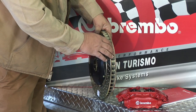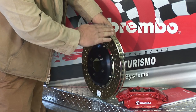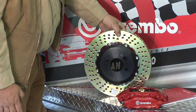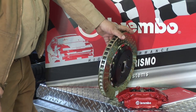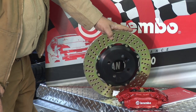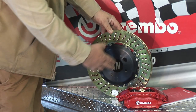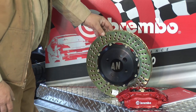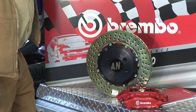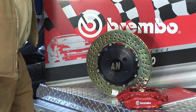These are some pretty unusual vanes — they look like they spiral outward from the center and back. How does that work? Brembo has really engineered a nice piece of equipment here. There are three ways to do a ventilated rotor: a straight bar, a straight vane, or a curved vane. Brembo has chosen the best way — the curved vane. That gives us a centrifugal pump effect to bring air from the inside of the rotor outward, giving us much better cooling.